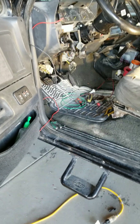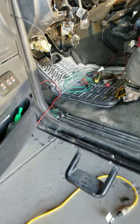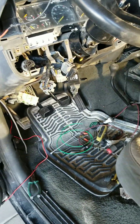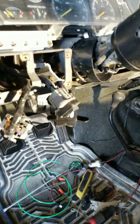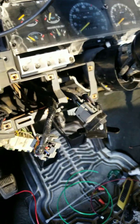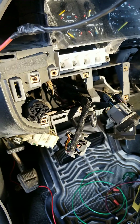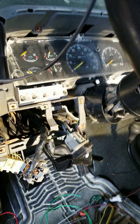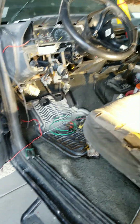The main points I want to make with this video — because I'm trying to save somebody else a week of their life trying to figure this out, because all these issues are different — if you have something that sparks or smolders from your motor and all of a sudden all the electrical cuts off, test the wires as far back as you can see, go into the hood, test those wires, try to find where the bad spots are, and look at the fusible links.